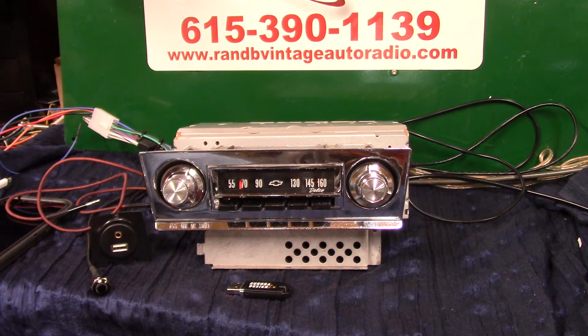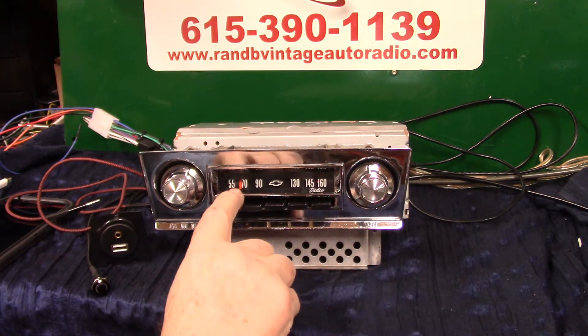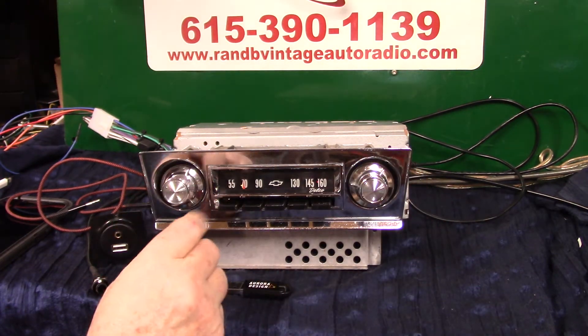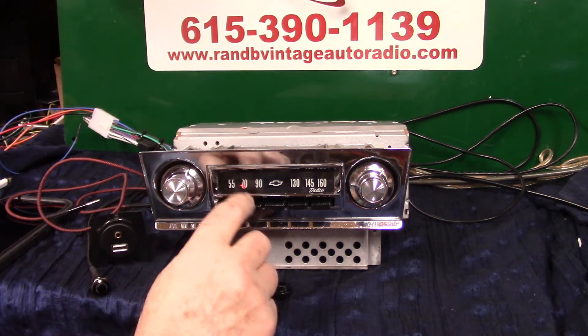These are pretty interesting — they do not require 12-volt consistent like an aftermarket, so you don't have to worry about memory. There's no batteries to change. You store the car, put the battery back to it, it goes right back to doing what it was doing. It's got a built-in loudness and EQ. Right now you're on FM — you've got a little stereo light over here showing you that's a stereo channel. Right behind this needle here is a status light, and it changes colors. You want to go to AM radio, just turn it off and it'll go to red — that's AM radio.